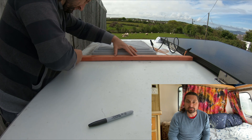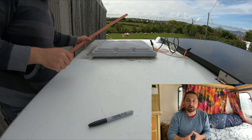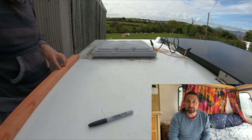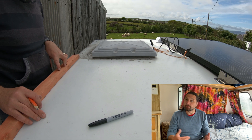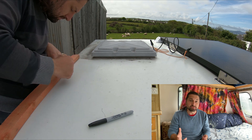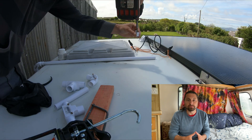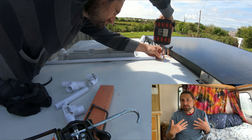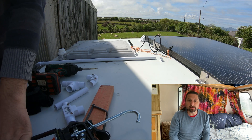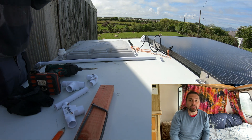Next I moved on to working out how to get the cables from the panel at the back of the caravan toward the battery in the front. Normally smaller solar panels are installed on the roof near the battery to minimise cable travel, however I'd have a couple of metres of cable run to deal with. Option one was to run the cable along the roof and down into the caravan nearer the front. Option two was to run it to the side of the caravan and then directly down through the wardrobe, under the floor and along the underside of the floor and back up into the caravan. Given that I wanted to install the charge controller nearer the front above the shelving it made more sense to install conduit along the roof.